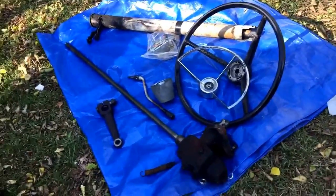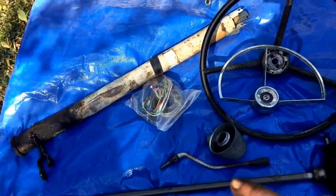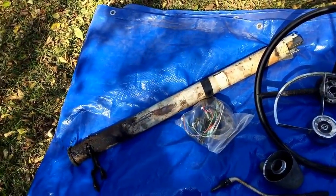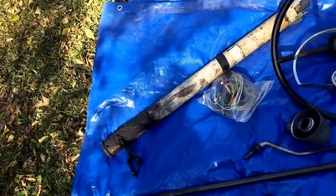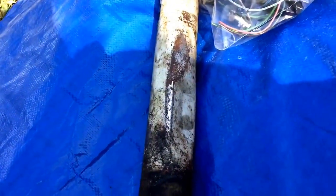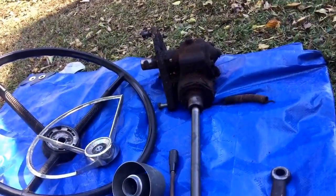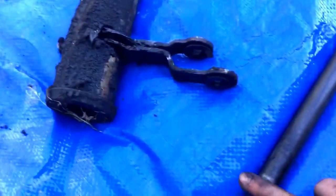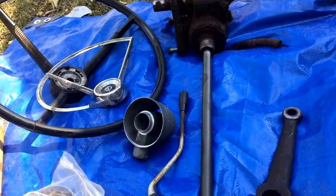That is the entire steering system from inside my truck: manual steering box, the little spring, pitman arm, steering shaft, shifter, collar, steering wheel, all those miscellaneous pieces, and the steering column — it's got the tube in there plus some shifting forks. Be mindful when you're pulling it apart. You can see this thing is a mess. I really don't know if that dent is supposed to be there — I'll ask a couple other people that own these and go from there. I have a feeling that somewhere along the line it had a major grease blowout, probably inside that box, with that seal that was stuck up here earlier when I pulled out that tube. We'll see when I go to dissect this thing. Thanks for watching.